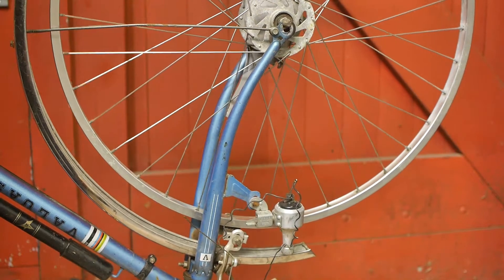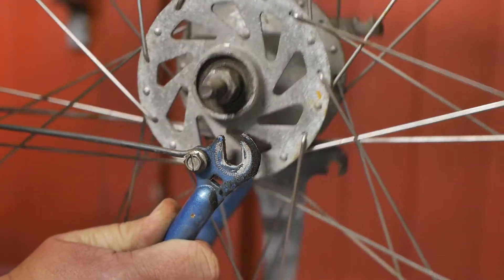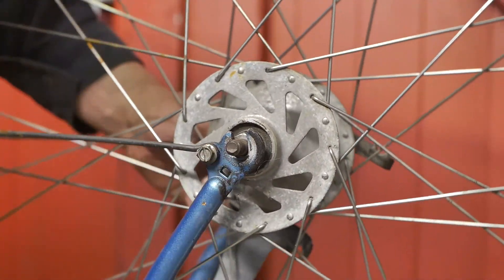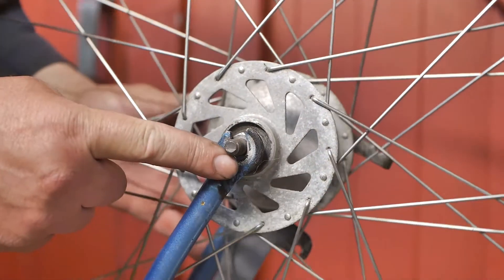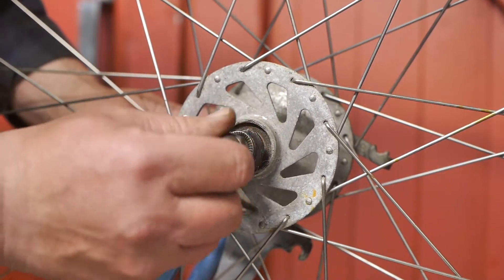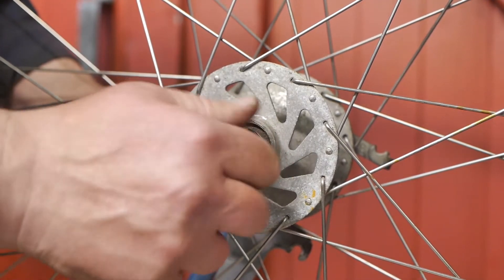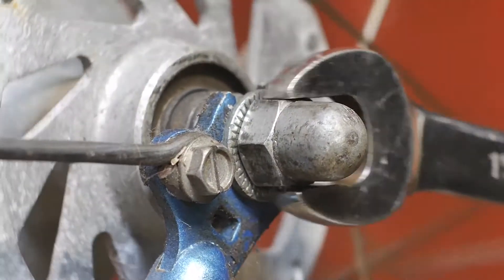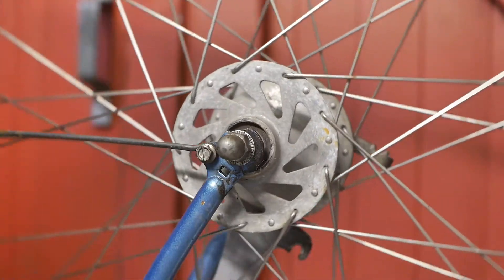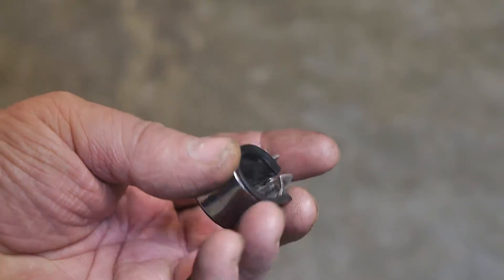It's very close and I might need to file it out a bit, but so far I haven't done any filing and it fits very nicely. The width of the axle is also perfect. I'll use a serrated washer and an acorn nut to keep things in place, nip it up, and I won't have to worry about the front wheel coming out. Next I need to install the bracket for the brake reaction arm.